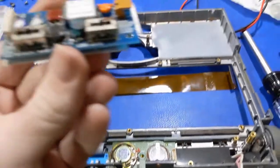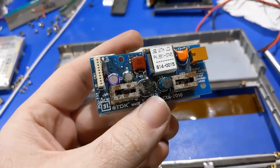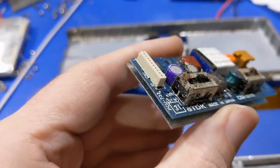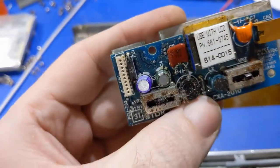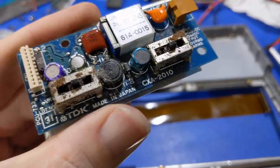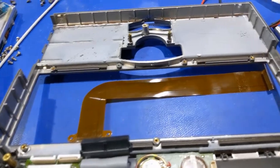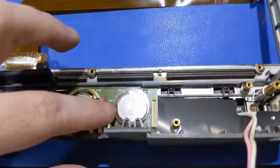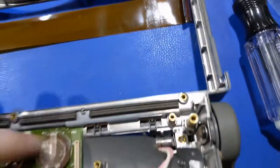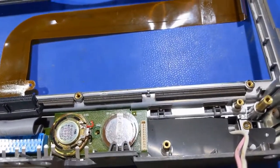I'm taking all the screws out and pulling the inverter out — it's nasty. I gotta look in my stash and see if I have another one. Perhaps more importantly, there is a capacitor we have to change on that. That purple one is a polymer cap — those are hit or miss — but that green one definitely has to go. That is crusty. I want to get this board out. I'm going to take this battery out — I'm not putting another one back in, because I'm not going to use this machine enough to justify buying a battery and putting it in there just for it to leak later.